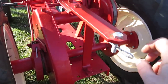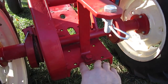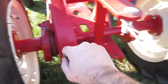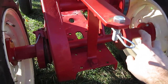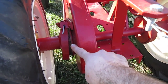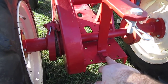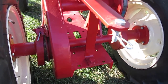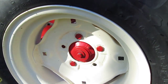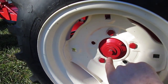Going to the back of the tractor, this bracket is incorrect — it's not even a Wheel Horse part and will have to come off, with more holes to fill. Interestingly, there's a ribbed hub on both the left and right side, which indicates this never had a brake kit — correct for an early 55. The prior owner said he remanufactured the pawls, which is typically not great, so I'll probably have to replace them. Somebody also drilled and tapped the end of the axle to hold the hubs on — that's wrong; it should have had a C-clip.